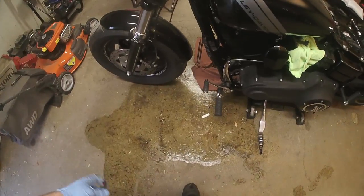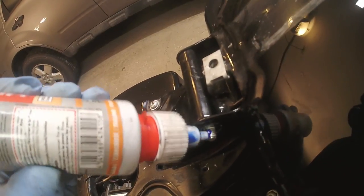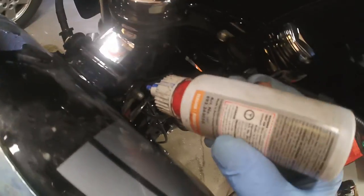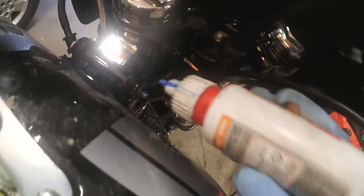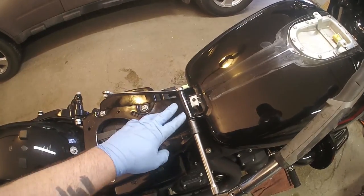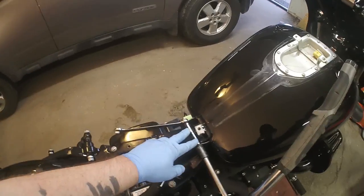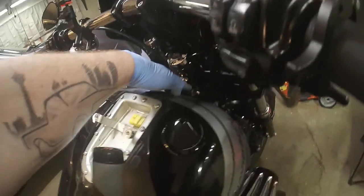Don't forget to hook up your fuel gauge if your bike is equipped with one. Slide your two bolts through and get a little bit of blue Loctite on them — don't forget about the front one as well. Then we're going to put those acorn nuts on with the washers. The torque spec for this is 15 to 20 foot pounds, so I'm going to torque it at 18 foot pounds, and that goes for this one as well.